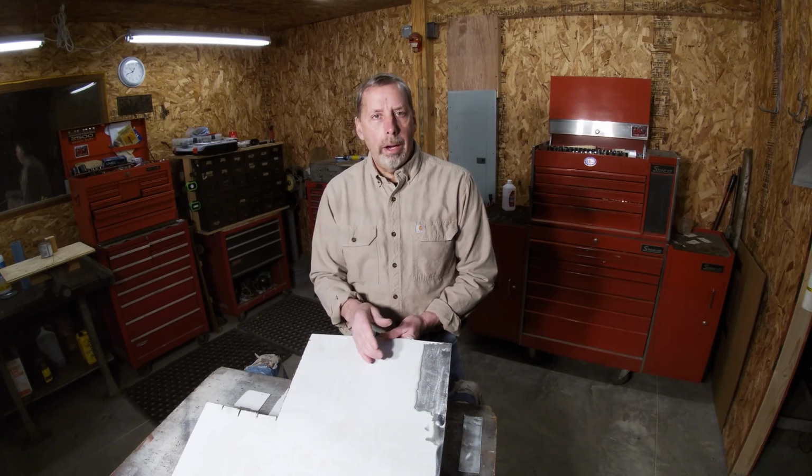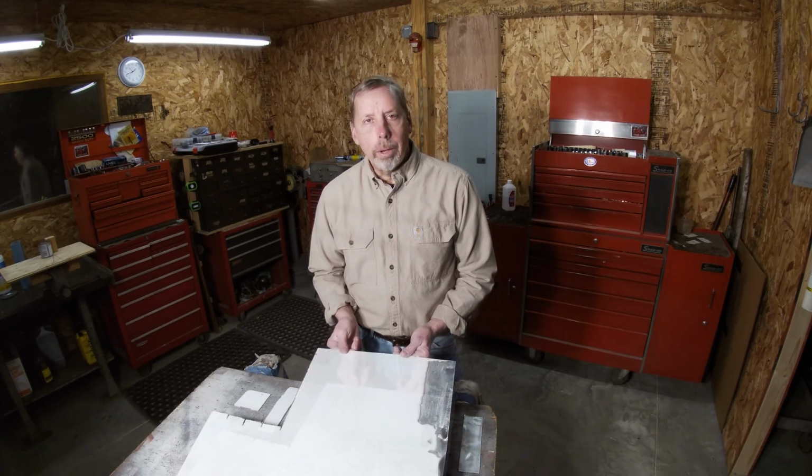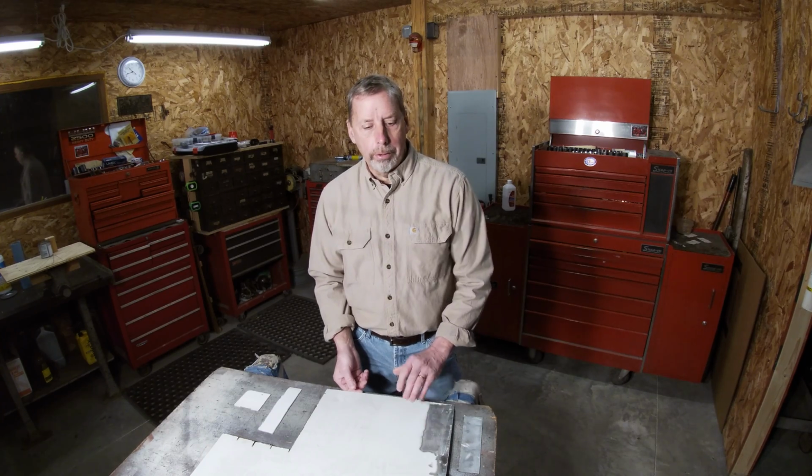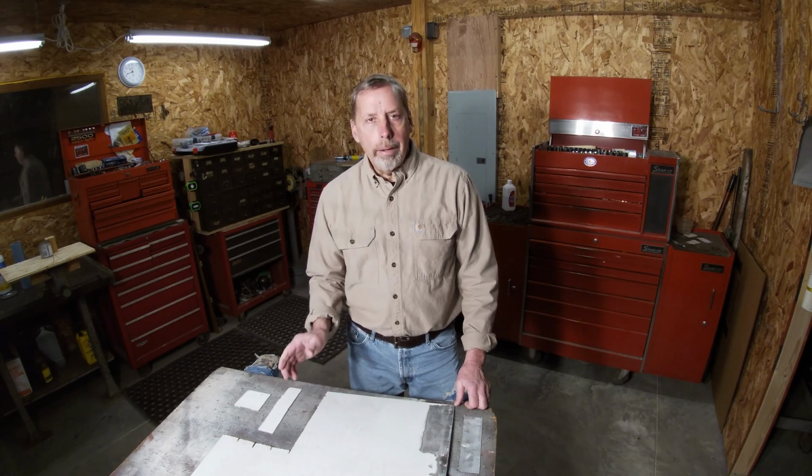Another thing the manufacturers want you to do, they want some epoxy on there or an etch prime. The only reason I don't do that is because I don't know how long it takes for this stuff to dry once you put it on there. Your filler will tell you it has to be a dry surface or a fully cured surface, but it depends how thick the primer is put on. It depends on temperature, humidity. Even if it's baked and you do it the next day, there's really no way to tell if that is thoroughly cured.